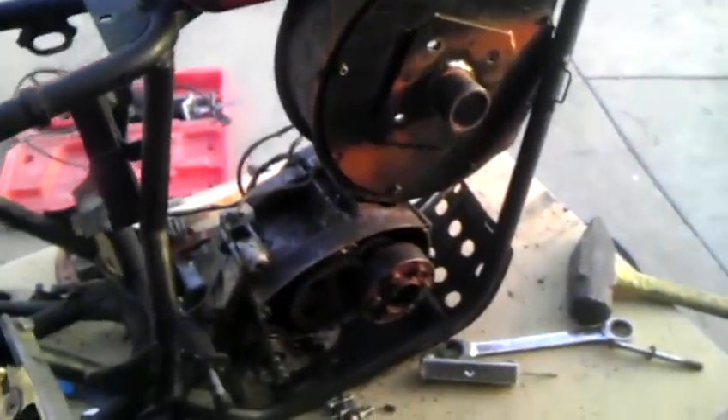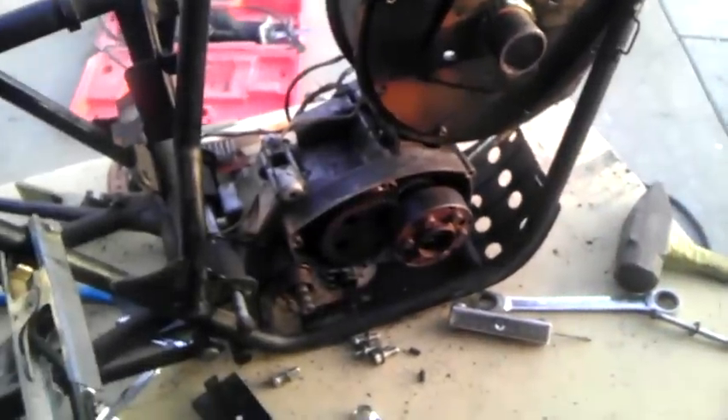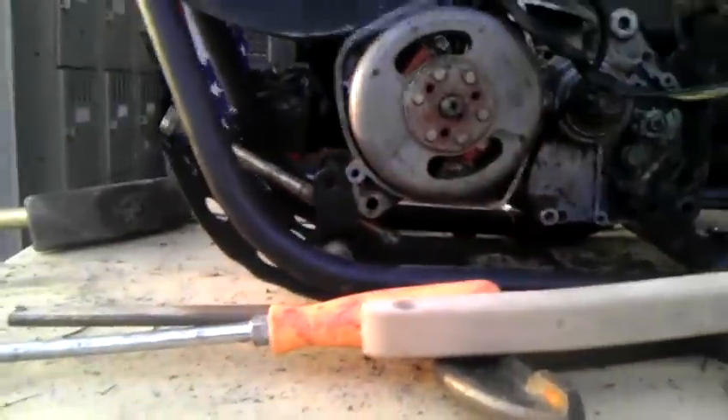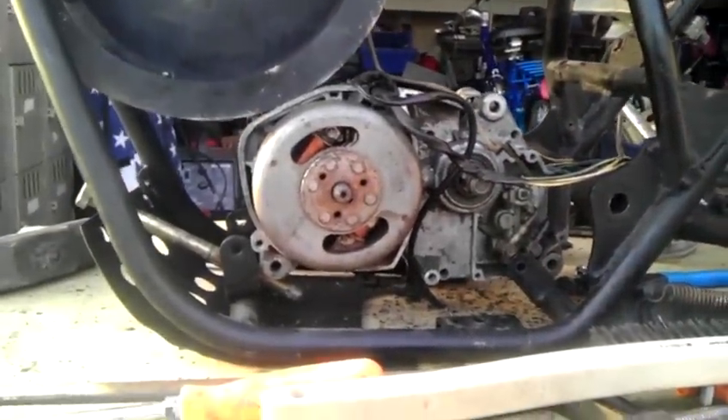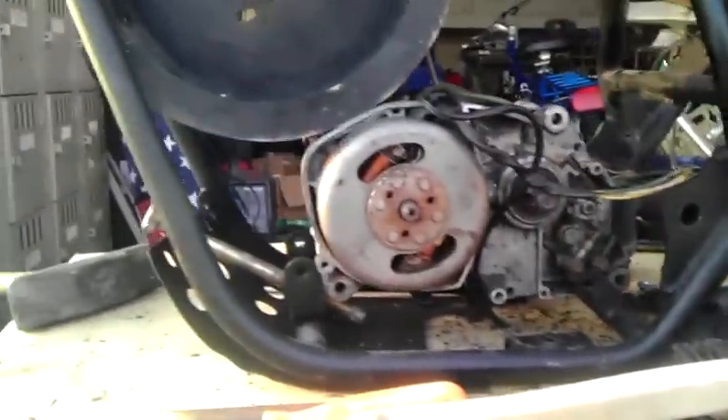What I'm going to do is basically drive the crankshaft belt. That way I can still use the motor's drivetrain and have an overdrive. Probably going to have to move the motor mounts a little, shave the bottom of the can to make it fit. That'll keep all the original clutch. Probably leave the magneto — that way I can charge a 12 volt battery for my lights.